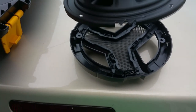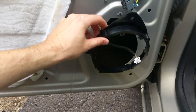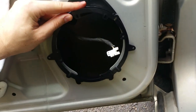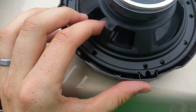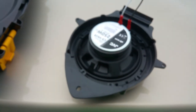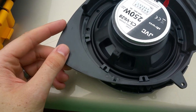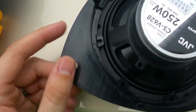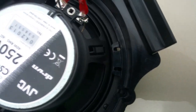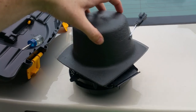I bought some JVC aftermarket 6.5 inch speakers and they came with this protective covering, so I'm lining up the screw holes on the covering. You also need this speaker adapter to fit the Chevy Impala and many other Chevys — this is what it will look like when you install it. I'm going to install this adapter to the speaker itself first. You place it on there, and one thing you'll notice is it doesn't line up perfectly north to north, so you have to offset it a little bit. The holes you want to use for 6.5 inch speakers are on these little tabs — you can see I've got them lined up there. There are four holes, and the screws that come with the speaker adapters should screw right in and hold right against the plastic.